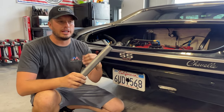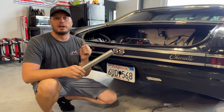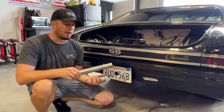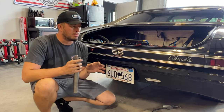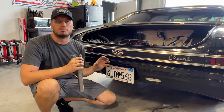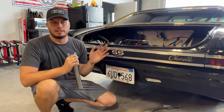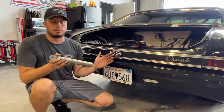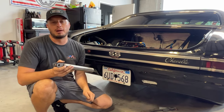It creates a dangerous situation. Either you're going to come down and mess something up on your car, you might dart into the other guy's lane, or you might land on the wall. I've seen it quite a few times over the years. Basically, what you want to do is keep this thing as tight as possible to the back of the bumper. When we build our kits in-house, we always try to keep them tucked real tight up there, because then, if you get up that far, it's not an issue. But if you get too far out, especially depending on the length of the back of your car — some cars are real long in the back, some are short — it can definitely become an issue.